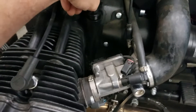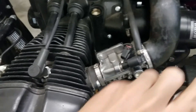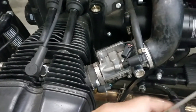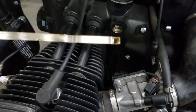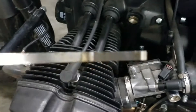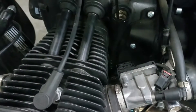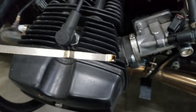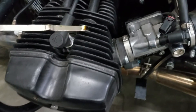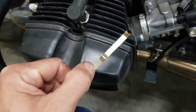Proper checking would be sitting on top here. We'll go ahead and wipe this off on a rag so you can see we're clear. Let's stick the dipstick in and pull it back out. There's your oil level — we are severely low, we are way too low.